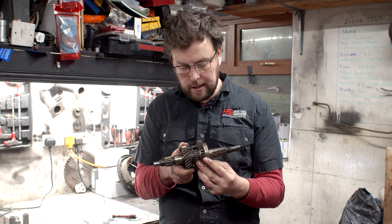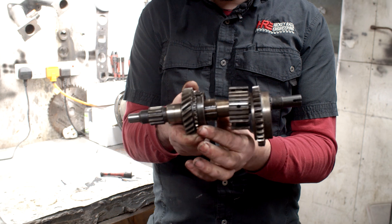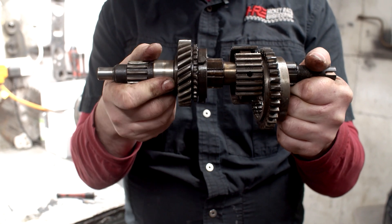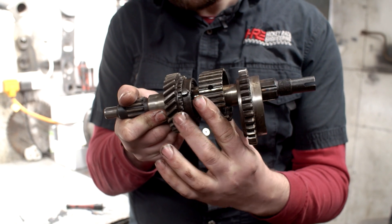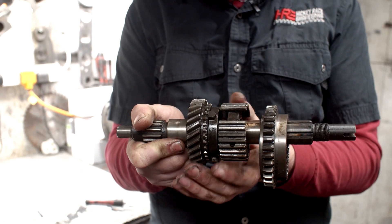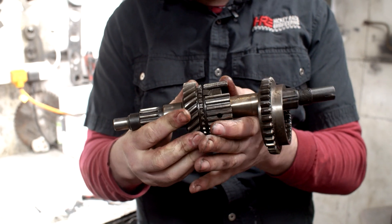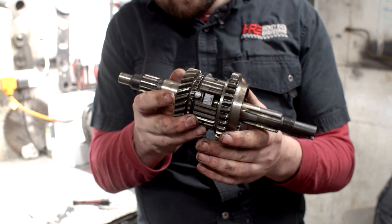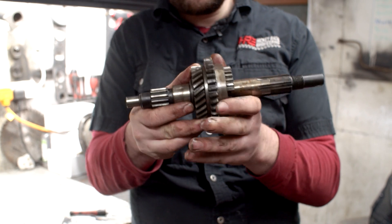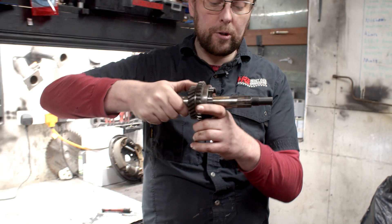So let's look at that just one more time and do an exploded view. What we've got is our balk ring — a clutch that is spinning freely on the gear we want to speed match. That gear is currently spinning free of that shaft, so the shaft is stopped and the gear is spinning free. When we want to engage that gear, we have our synchro hub inner which is splined to the main shaft. It comes in and joins that loose balk ring to the gear we want to speed match. The two of those then get driven by the output shaft to bring up the speed, and that will allow our gear selector outer to get its dog teeth to engage. And then off we go — we have drive. We've now connected the layshaft to the primary and to the output shaft, the third motion, and the gears drive.